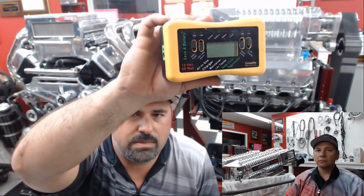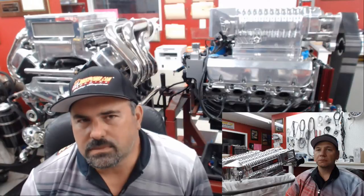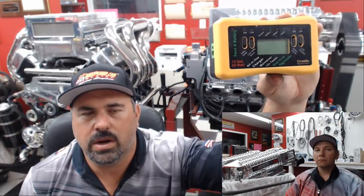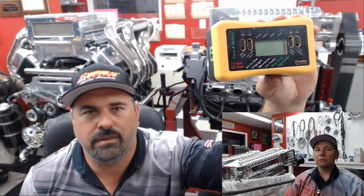My suggestion is to get a pigtail on your setup and plug in a battery charger — whether a pulse charger or a regular battery tender type — and always keep your batteries tip top. For storage facilities without power, rig up a solar panel or remove the batteries and take them home on a trickle charger so you always have a fresh charge and no drama. Different batteries take different periods of time to charge: there are gel batteries, AGM batteries, wet flooded batteries, deep cycle and non-deep-cycle. Just make sure you use a quality battery.